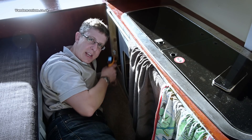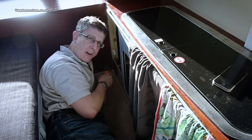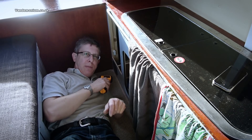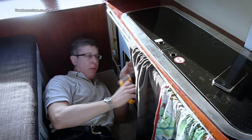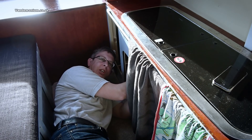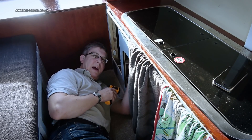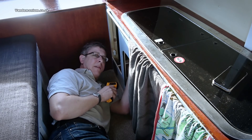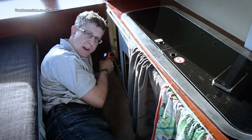Just where the pipe is exiting the van, where it goes out through the holes in the bottom, it's saying it's about 55 Celsius. It's been running for a good five minutes now, so it should definitely be up to temperature because it's really warm in here. We're still reading around 140 just as it comes out the bottom of the heater. It goes down to about 90 to 80 degrees quite quickly as you go down a couple of inches down the pipe. And then as it exits the van it's now about 62.